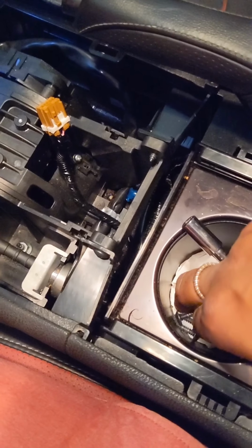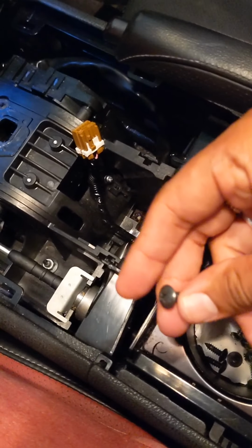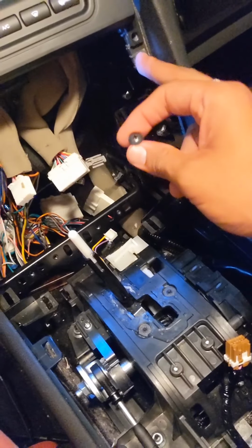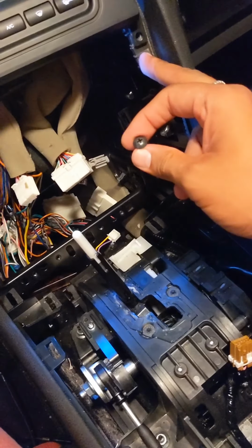The good thing with Nissan is that anything on plastic trim, especially all the black pieces, for example, beside the R switches that held the climate audio control panel in, those screws and the screws that held the sound system cover in, the Bose plate, since they're all plastic trim pieces, their screws were all black. And then the multifunction display unit and the stereo system, that built-in amplifier, were metal flanges screwed in, and the metal flanges had all the silver screws.